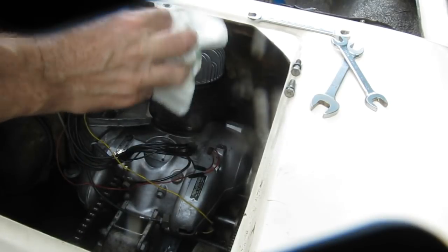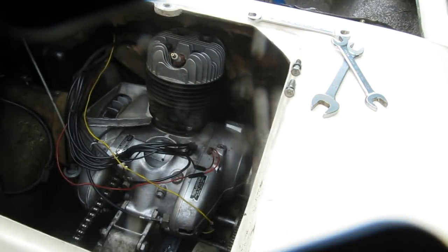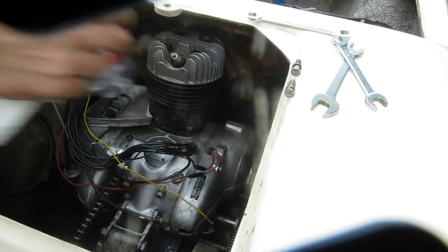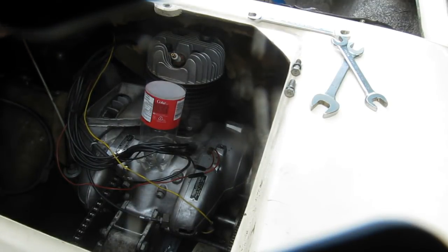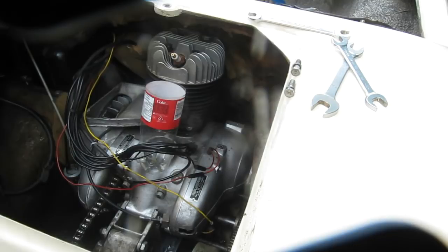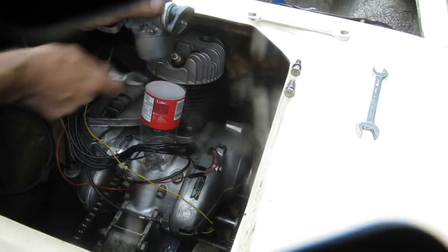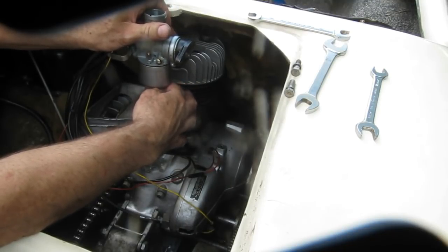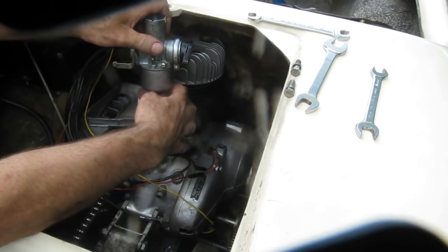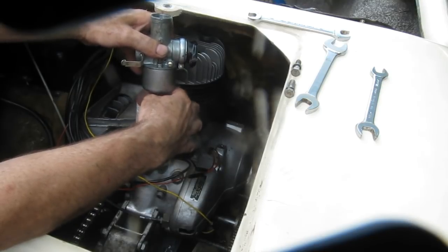Okay, so the carburetor is off of the engine, and there's probably a float bowl full of fuel. So put it into an approved container. Take the bowl nut off. Easier to do if I had the right wrench in my hand. I'm just going to take the bowl nut off here and drain the fuel into a clear container, just to see if there's anything there besides fuel in the float bowl. Get the bowl nut right off here.